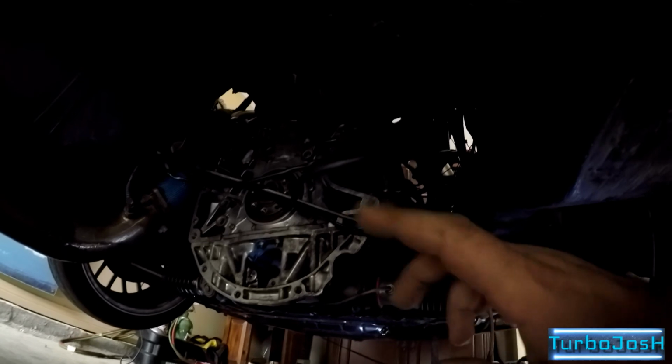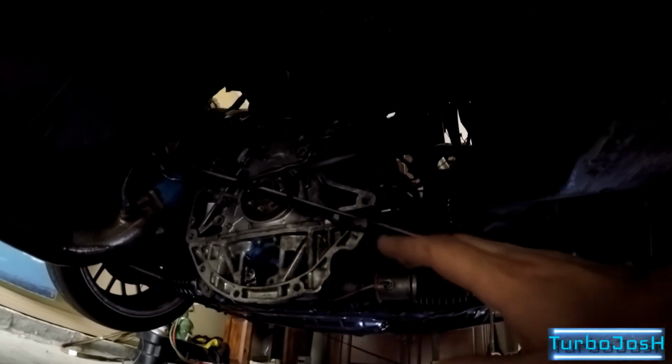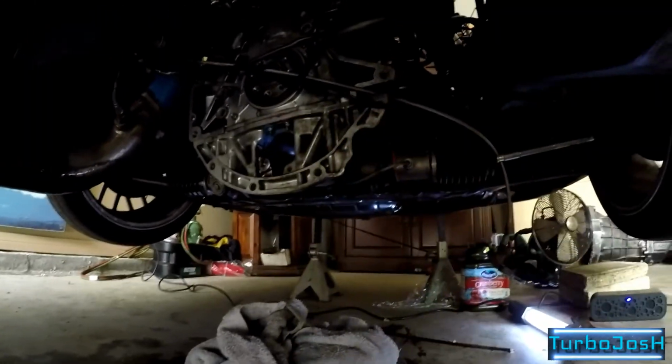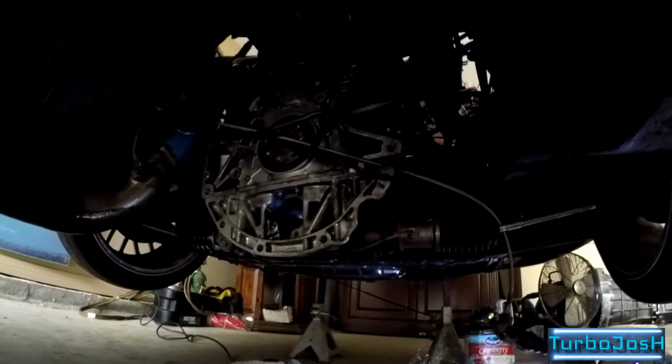The transmission seal was actually leaking where the input snout comes out, and I took that OEM gasket out and just put silicone there. It's been fine ever since. That's over there fine and not leaking. Put it back together, leaked again. Found out it was that leak, took it apart, thought it was the old leak from the return, so I fixed that, tightened it, cleaned it, put it back up. Officially leaking uppercase now, so right now it's off the mounts. It's just sitting on the cross member, so to speak.